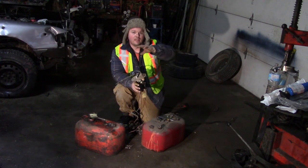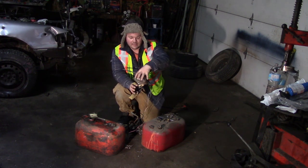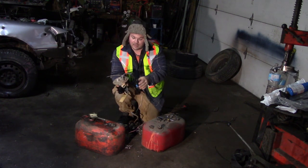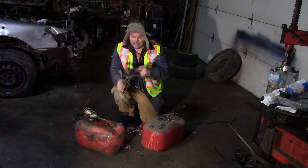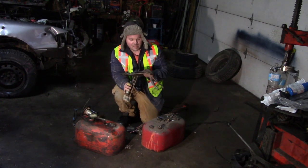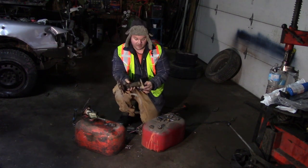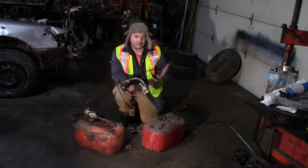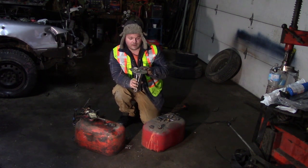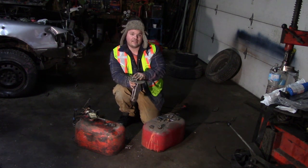GMs have these twisty things and a lot of new Fords have a big twisty lid - I don't use any of those. What I use is a lid that can be tech-screwed down. What we have here is a newer-style Toyota Camry pump with all the wires, and here is a Honda Civic or Accord pump - I really like these Honda Accord pumps, they go right to the bottom of the tank with a pretty high PSI system to run basically any front-wheel-drive fuel-injected car. And for rear-wheel drives, this right here is out of a Crown Vic - an older style, basically 1997 and older.